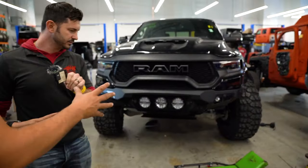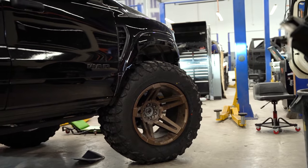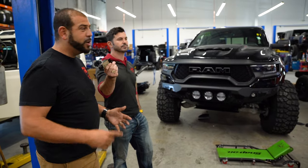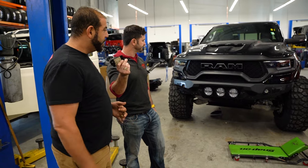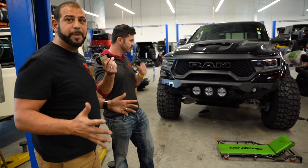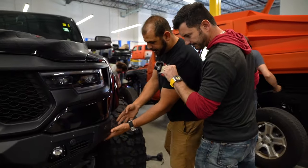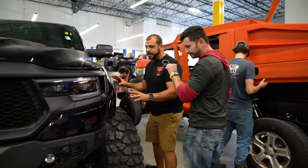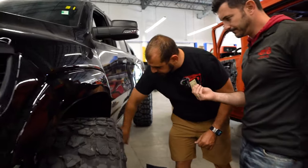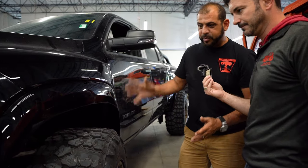Why don't we walk you around the front? We started out with this bumper and we have to modify the hell out of it. The big magic behind this truck is that it's got 40-inch tires, and 40-inch tires give this truck the big bulldog look. It's a 707-horsepower Hellcat that we do stuff to — 800 horsepower with a smaller pulley, bigger injectors, and a tune. We have to modify the frame and the front cradle to push those wheels forward a little bit and boost the wheelbase by about three inches. Notice we modified and welded back the bumper to clear all this stuff. This whole fender is about an inch and a half wider than the factory fender.